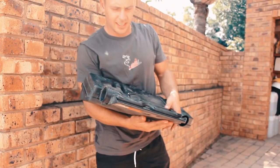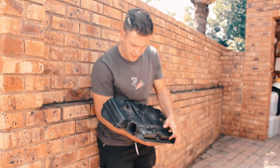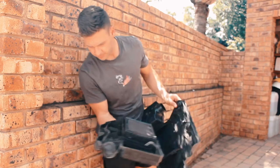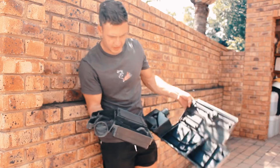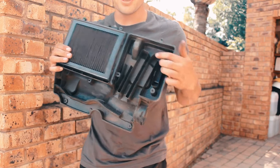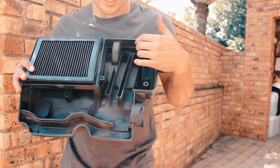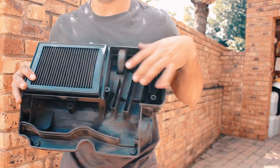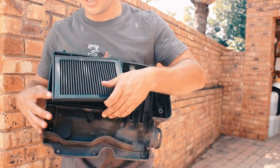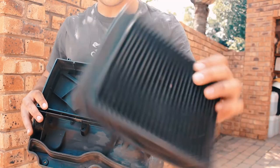This is why it takes so long to service the Ford Figo — because of all these damn screws that you just undo for the freaking airbox. When you're finished undoing your last screw, you're going to take it off. As you guys can see, if you open up your air filter box, there's another thing here but it just diverts the air that comes straight into the intake. I took that out just so it can run freely. And here's my K&N air filter — drop-in air filter. Yeah, this box is so dirty, definitely needed a clean. I'm glad I did this today.